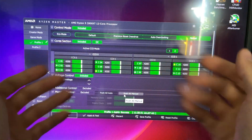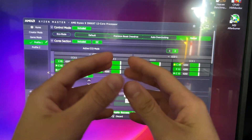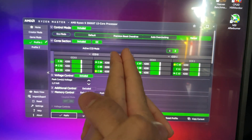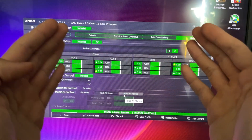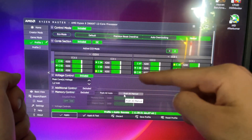Now in case you wanna stay a bit more, we'll discuss what we have done and what you can do to improve it yourself. Out of the box, Ryzen CPUs go all the way up to 1.45V, which is really high — here we are at 1.2. They do that because they overvolt the CPU in order to reach higher single-core frequency. It's called PBO — it's AMD's Turbo Boost. The problem with that is the frequency goes up and down constantly.